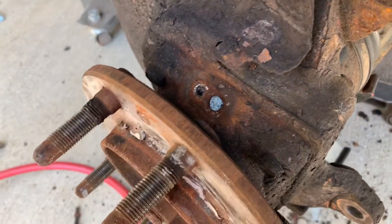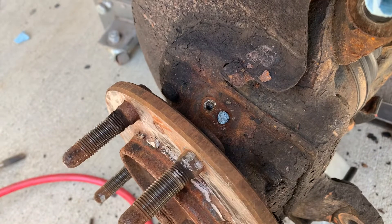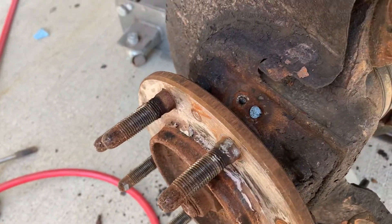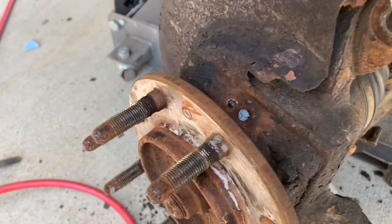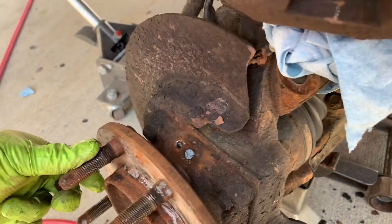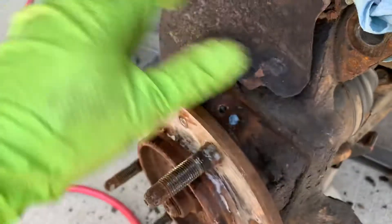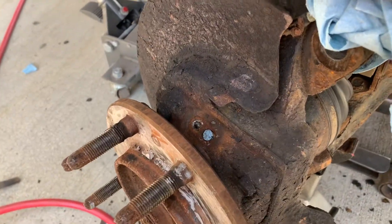You can spray a little bit of paint over it, wait for it to dry, and plug that hole so none of the debris gets in. Paint it, let it dry for about five to ten minutes, then go ahead and put everything back together and torque everything down to spec. That should get rid of the ABS engagement at lower speeds. If you still have the issue or the ABS light comes on, there's probably something else going on — you might have to replace the hub or the sensor if you damaged something while cleaning. If you have any questions or comments, go ahead and comment below.